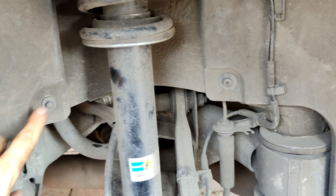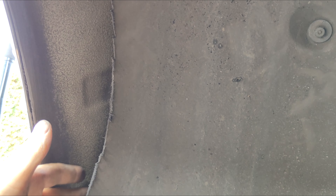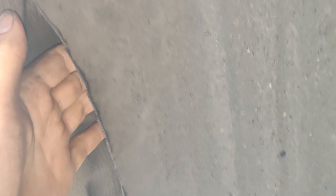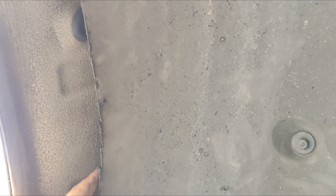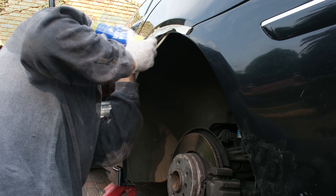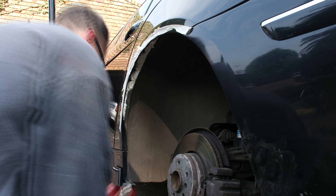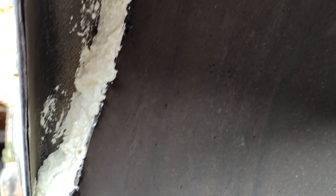I've put the cover back in and the ABS sensor is packed away - push pins are in. The next step is to use filling foam. I'm going to squirt the foam on the inside all along where I cut it. The reason for the foam is that we don't want water, sand and debris getting inside, so it's going to block that off and also reduce some noise. I just use a scraper to push the foam inside, then I leave it to dry.